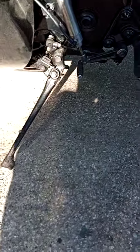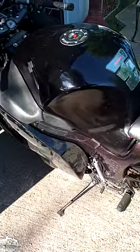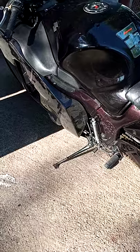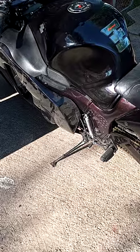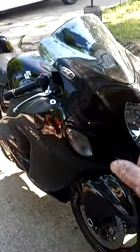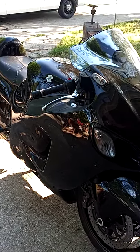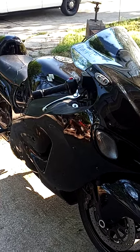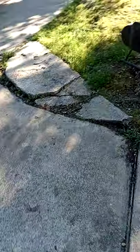No leaks, no nothing — and I just came back from an 80-mile ride. I popped the seal from the outside, because you're supposed to crack the engine cases open to change that seal. I ain't got $2,000 to pay nobody for cracking the engine in half and taking the motor out. So I popped the seal from that side. You can get aggressive with the grinding. Just make sure that seal goes in and out.